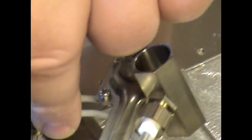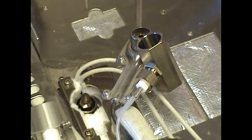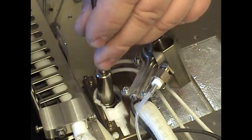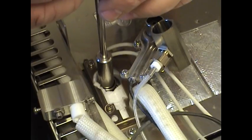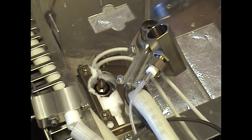Next, take the new ferrule, or it could be the new jet with the ferrule adjusted on it. Drop that in there gently. Take the tool. Make sure to keep it up and down — do not bend it right or left or you will snap it. Snug that down. Now it's seated.